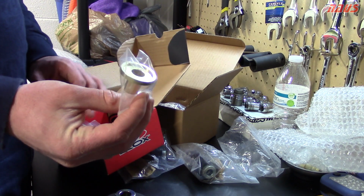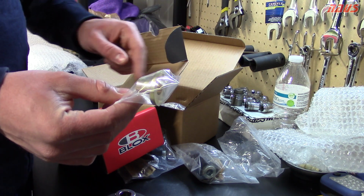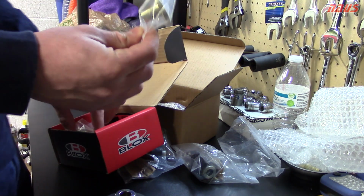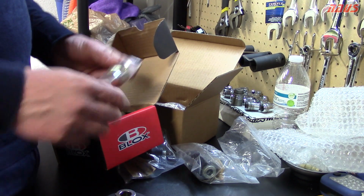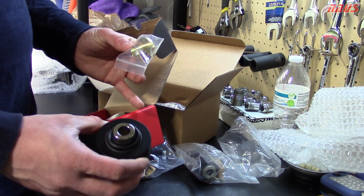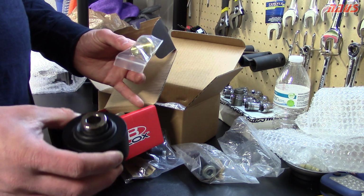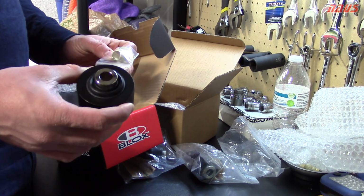If you haven't seen my video on what rigid collars are, click the link in the description. I explained them very well. But these basically eliminate all play in the subframe. So the combination of these and the spherical control arm bushings would have completely kept the whole subframe and control arm system rigid in the car and would have completely reduced wheel hop, I believe.